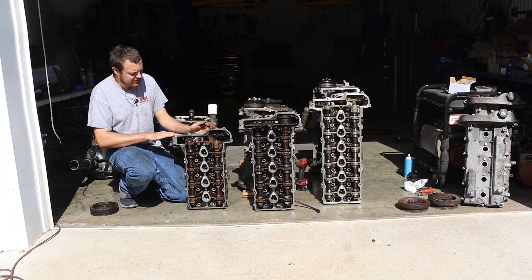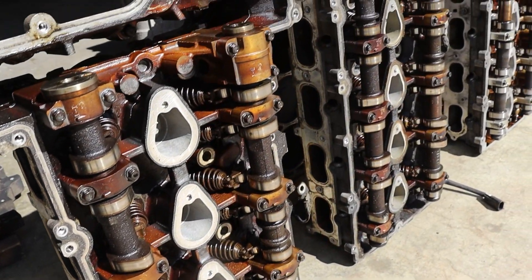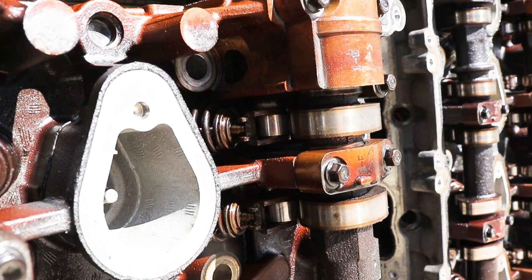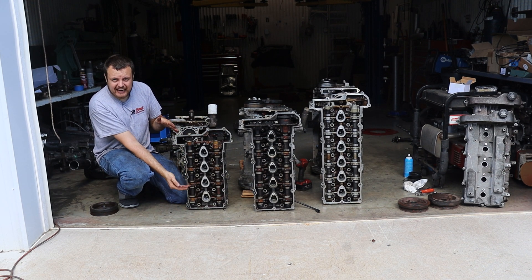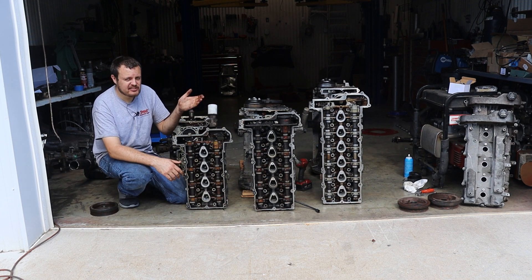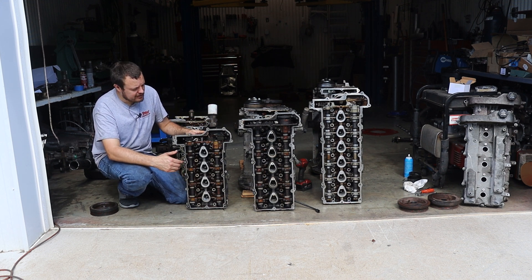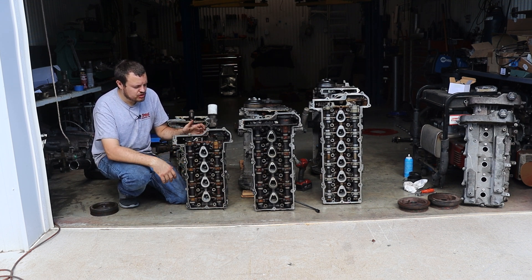Let's talk about the cylinder heads. The majority of the components — such as the cam followers, valve springs, and valves — are identical across the board. All Gen 2 engines received the same upgrades: a larger intake cam and larger valves. The cams are shorter with different cam timing to accommodate the 4, 5, and 6. As it stands, regrinds are only really offered for the 6-cylinder platform, but they could easily be developed for the 4 and 5 because it's the same lobe — they just have to change the timing on the cam grind.